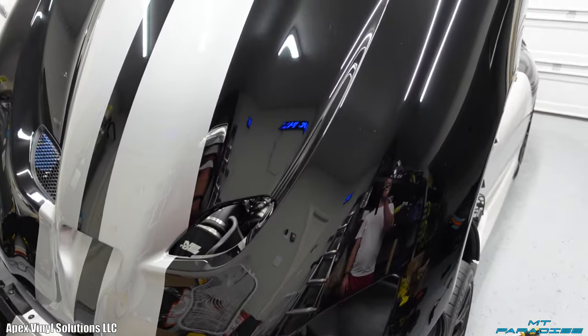There's no overlapping. And then once I slap a piece of satin on here, it actually hides it very well and you barely even see that line. Also got a lot of coverage here. A lot of people would have left a gap and then had just a little overlap on each side. But to me that looks kind of bad and it shows a lot of the overlap. But I'm doing this method and I'm pretty sure it's going to work. Like I said, I did some sample vinyl in the back of my car just to try it out. And doing it this way, it's less obvious that there is any overlap. So then I went ahead and measured, got the little masking tape spots here just to mark out where it was going to go. Took the knifeless, lined it all up.